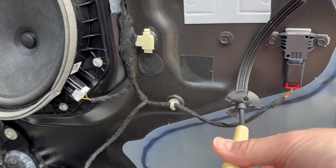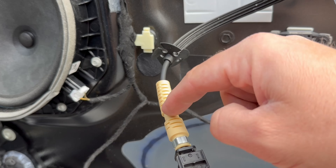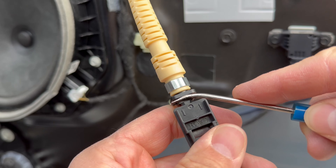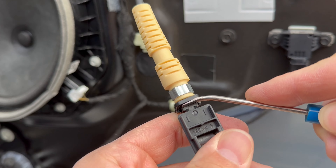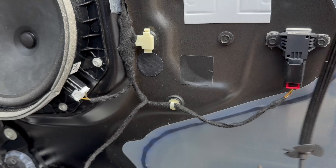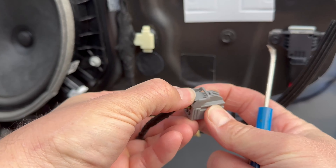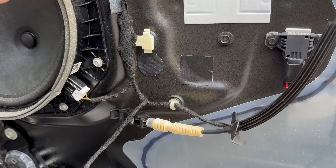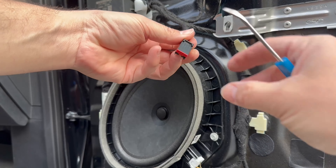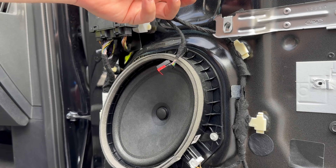This part is where a lot of folks are going to wind up struggling. If you look at the back side of the release mechanism, you can see these little arrows — what they're indicating is to push down on this little plastic piece right there. Once you do that, this will tilt out of the door nice and simple; you won't break anything. For your other connectors — the gray connector has a little push tab, and the connectors up here are the same: little push tabs. Makes this pretty easy.